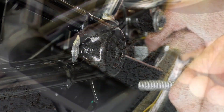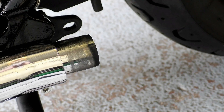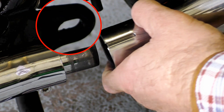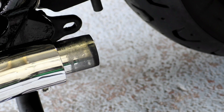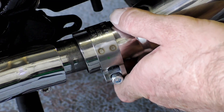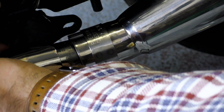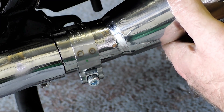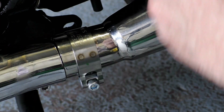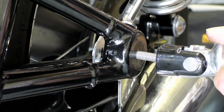The procedure for the left-hand silencer is pretty much the same — there are just one or two things to watch out for. If you're removing the original Triumph silencers there is one additional bolt holding this side on. That bolt is there for two reasons: one is to take the force from your main stand when it's folded up, and the other is that your outlet pipe from your catalytic converter or cross pipe relies on the silencer to keep it in place. With both the Sleeper Pros and the Predator silencers being much shorter and lighter than the originals, this fastening point isn't required, so you won't need to replace that bolt when fitting the British Customs silencers.